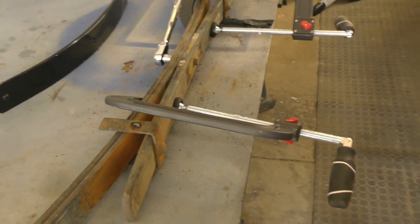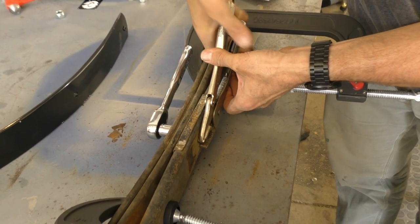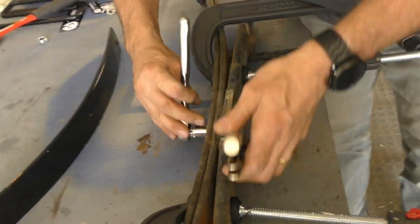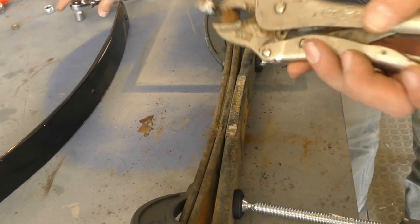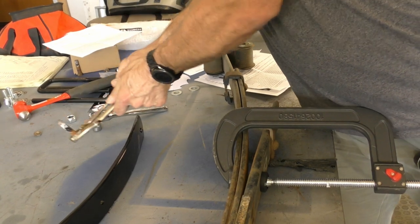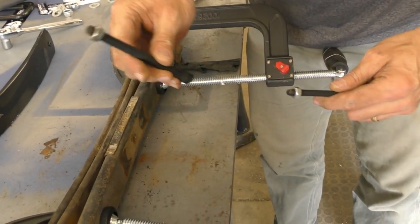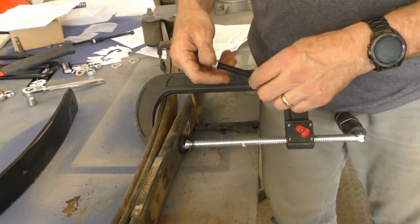Grab the vice grip. You want to grab onto this head with some vice grip so that you can get that nut off if it's rusty. Okay, so this bolt we won't reuse. The system came with two replacement bolts. It looks like the big one fits, so we'll use the thicker diameter bolt and discard the other one.